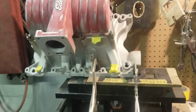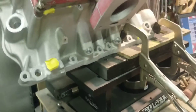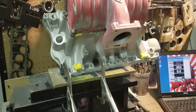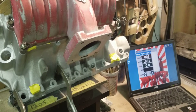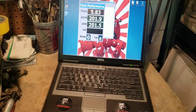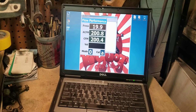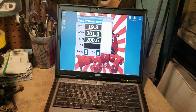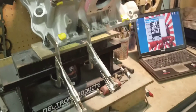We're going to pause it and set up the number four. The number four — let's see what that does. So we have it set up for the number four runner. If you're familiar with our videos, you know how we block off everything up here except for the runner that's going to be flowed. So let's see what this one does. 200 and two, three — basically 200, 201 CFM. Wow. 200 to 202 CFM on the number four.